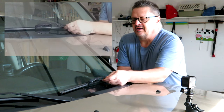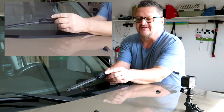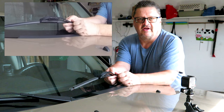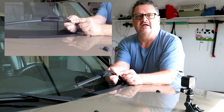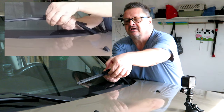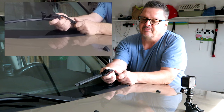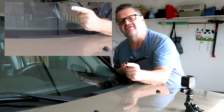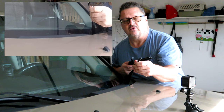Let's start with the driver's side. These wiper blades are the Bosch brand and this is a hook-style wiper arm. We're working on a Jeep Patriot, but a lot of vehicles these days have the hook-style wiper arms. On these Bosch blades there is a cap — you squeeze on the sides, lift it open, and pull the blade towards you and it comes off the hook. You can see why it's called a hook style because it's shaped like a hook.